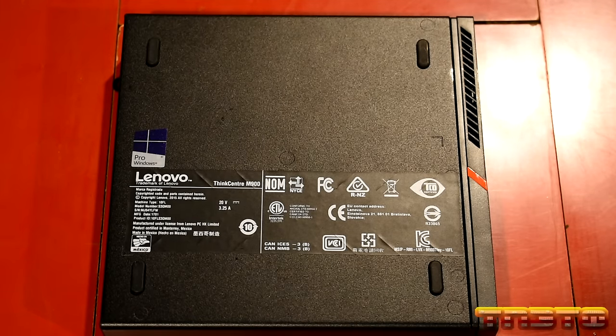And then when it reboots, we're gonna go back in the BIOS and set the date and time. It doesn't have to be dead on, but you want it to be relatively close. Like I said, when you replace the battery, it will reset the date and time, so we're definitely gonna need to do that. So as it's booting, just tap on enter. It does take a little while, it's normal. And F1, we're back in here. So we got system time and date. And as you can see, it says that it is midnight of January 1st, 2015. Well, that is not correct. So we're gonna have to update that.